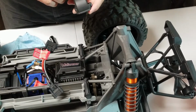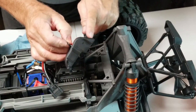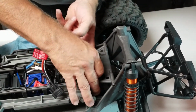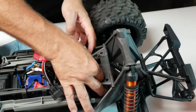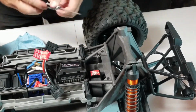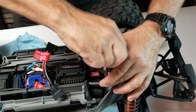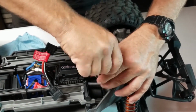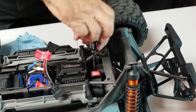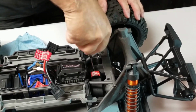Spur gear is changed, it's greased, everything is tight. Simple matter of installing my dust cover with the screws in the cover. Drop it in here like this, snap it down in place, and these screws back in here. Button this job up. Get this thing out and see what kind of performance we get with the high-speed gear. I think it's going to really wake this truck up.